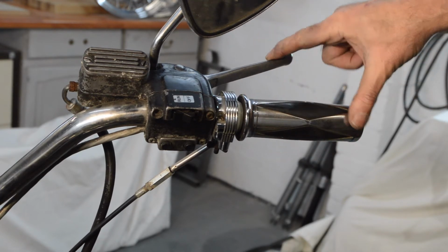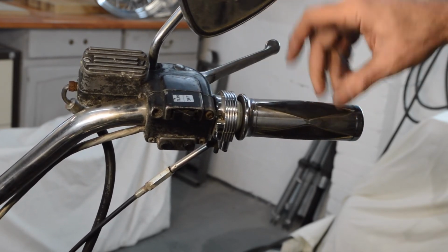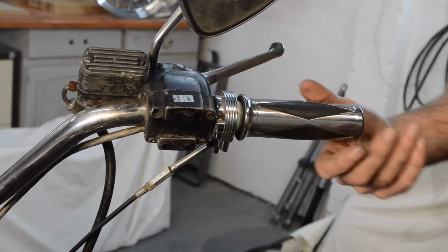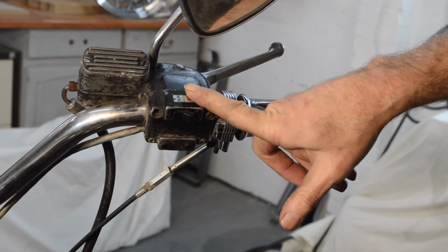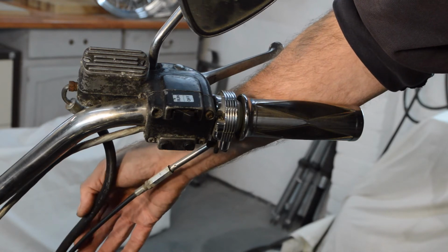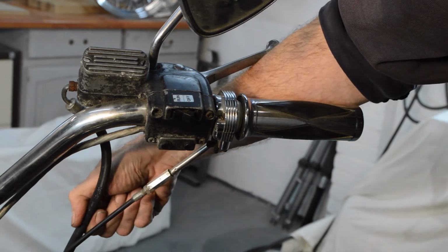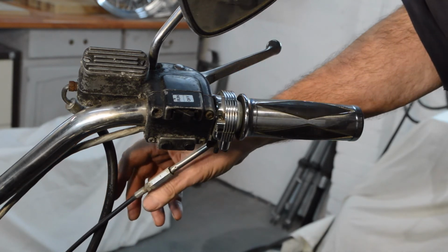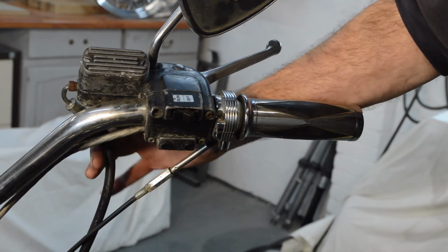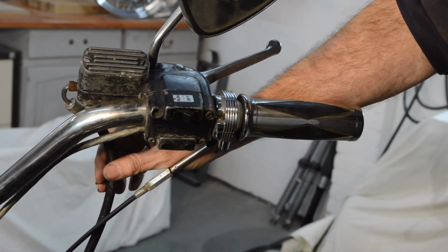And then whilst we're up here, oh dear, no brake. So I'm going to have to look into that as well. Hopefully just a seal kit will sort that out. The hose, which doesn't look original to me, appears to be marked up March 18. The rubber's nice and soft still, so presumably that's been replaced. It doesn't look like the proper one to me. It just looks like a general automotive hose that's been made to fit. But as I say, I don't know my Harley, so it might be right. I'll have to look into it.